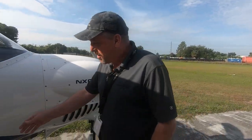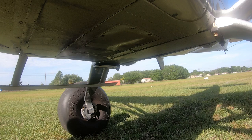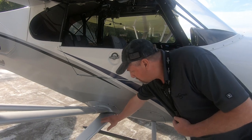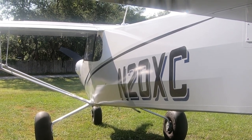If you look back here, you can see there's a fairing right here when the airplane is in its tail wheel configuration. The X Cub can be configured as a tail wheel airplane or nose wheel airplane, and can be converted back and forth. In the tail wheel configuration, the spring aluminum landing gear bolts on right here. In the nose wheel configuration, it bolts on at this aft station back here.